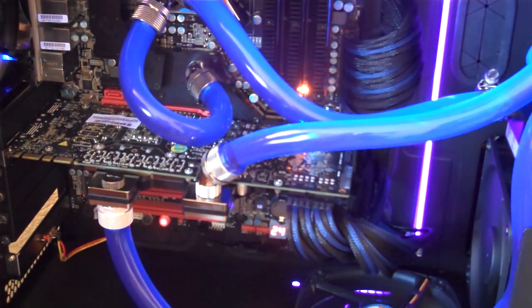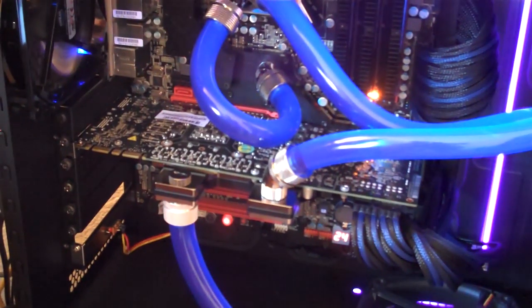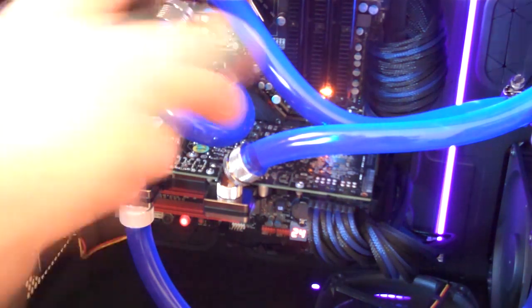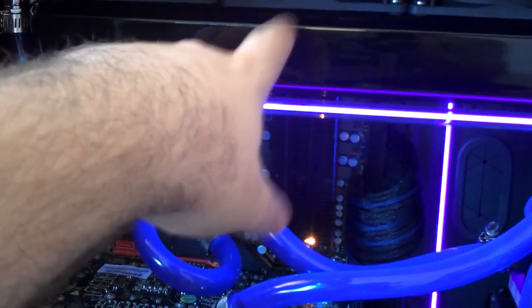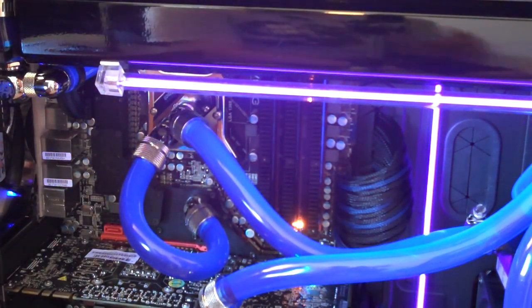Again, creating a lot of cooling potential for the loop for the graphic cards. Again, the card went from 31 Celsius idle to 24 Celsius idle, so you can't complain just by adding the 240 rad down below. Also, the CPU temperature dropped because the fluid flowing through the 360 rad up top is cooler, making it so when the fan blows through air, it's not heating the air up as much, etc., etc. So, it's a win-win in every case.